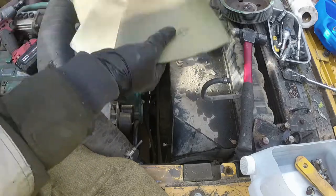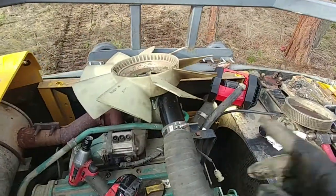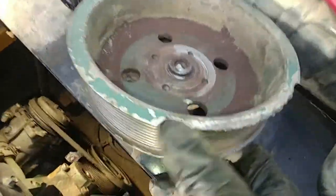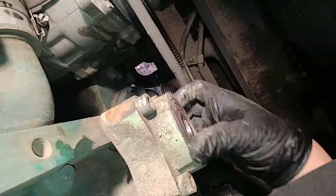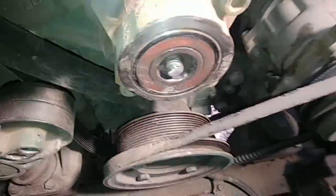We won't have proper balance, and it seems okay on the rest of the impellers but we need to put a new one in. We also have a cut on the upper radiator hose but it's not all the way through yet. The pulley — I can see the inside lip is gone and it needs to be replaced as well. Here's the hub — you can see the bad bearing on the outside and the part of the broken bolt. The housing of the hub is still fine; we'll just put in new bearings. Seems like the bearings are okay — just a bolt failure.